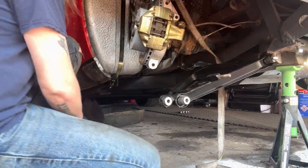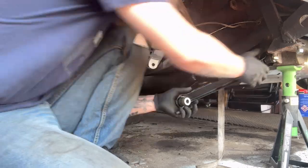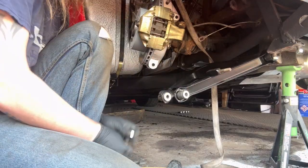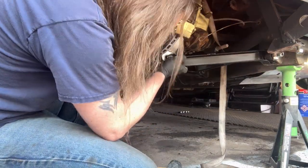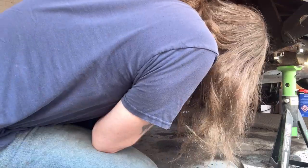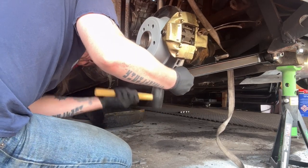While it's not a particularly exciting process to watch, it's fairly standard — the opposite of the strip-down video we did, just putting everything back together. Because everything is now very clean and brand new, everything goes back together a lot easier. We're not really having to force anything too much, everything kind of slots in as it should. We're going for new nuts, new bolts, new washers where we can, and where there are specific bolts with specific plain shank lengths, we've given them a thorough cleanup on the wire wheel then used thread chasers to make sure all threads are in good condition.